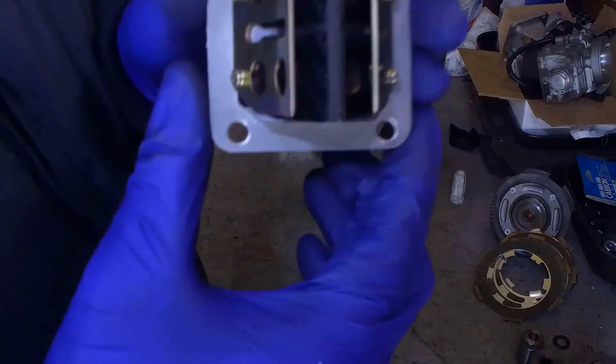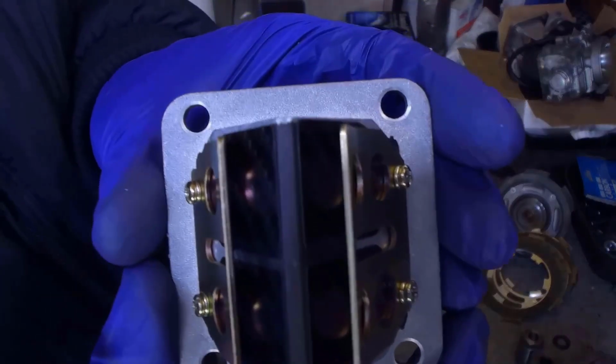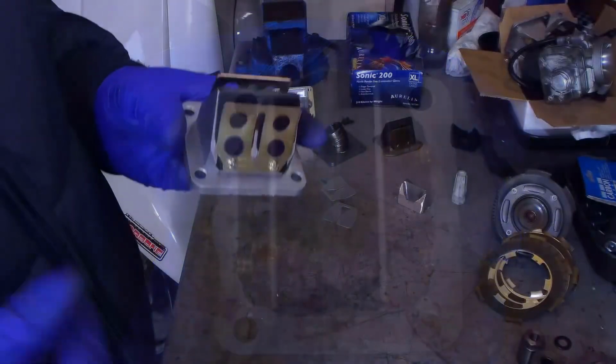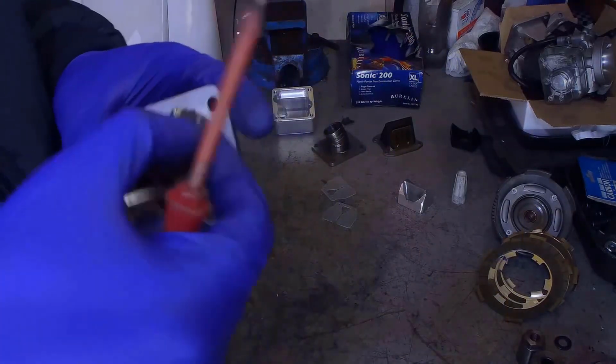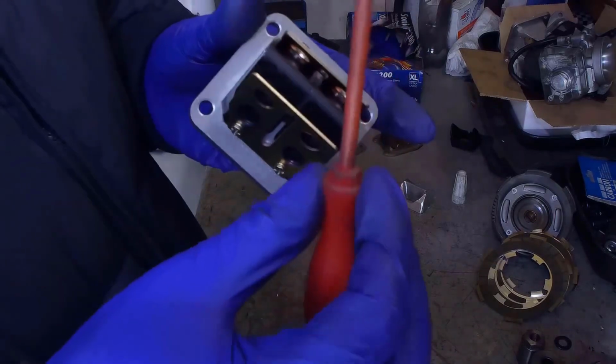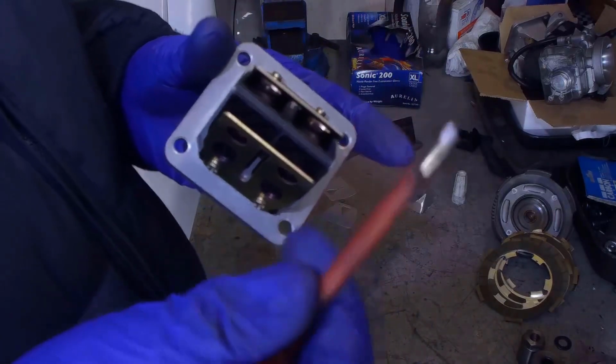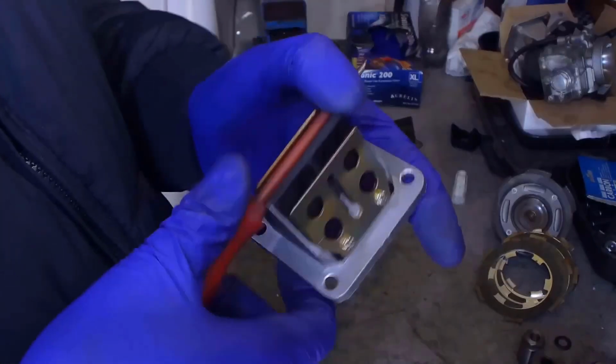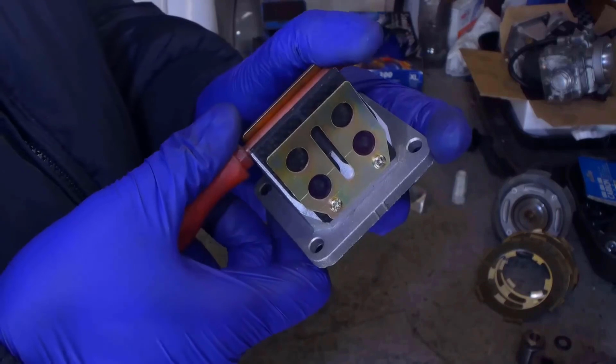As I already checked, the reed pack is perfectly closed. We'll complete this work by slightly enlarging the stoppers with a reinforced screwdriver. Let's not overdo it, just make it spin.